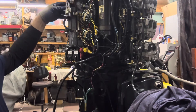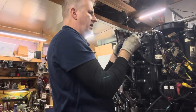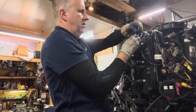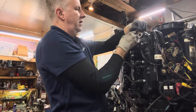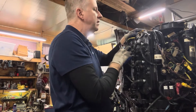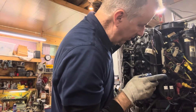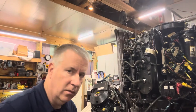This is our connection for our ignition. We have the brown circuit, which is our ignition kill wire — which is another brown wire here that we're going to connect. We'll look at it closely to see if there's any other connections we missed. Now we just need a ground cable from our battery to ground, because we already have our positive cable here. We're ready to go.